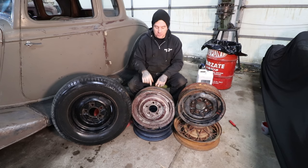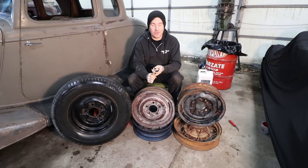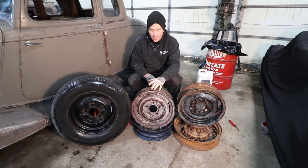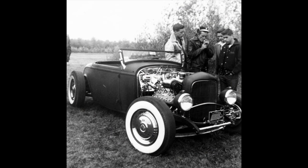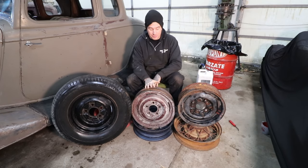40 Ford also came with a bunch of accessory type items: there is a rib trim ring that fits any 16-inch wheel on the outside, and an inside rib trim ring that is ribbed stainless that clips around and covers the face of the wheel, and then you can also run a hubcap on top of that. You can really change the look of your car from week to week or season to season just by changing a couple of those little things. These wheels in 16-inch form have the 4-inch standard, and there's actually a 3.5-inch version that's the V8-60 for 40 only — very sought after and very hard to find. Trucks also got wider wheels: 5 or 5.5 inches wide, and there's a high-clearance 18-inch wheel that looks just like this in the face.